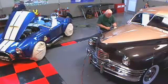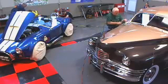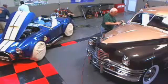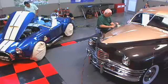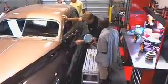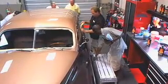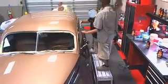One thing I know, and this is a personal thing, is I hate getting splatter on other people's cars. I don't want them to use my name as a cuss word down the road every time they look at it, because those rubbers, with the silicone that comes from these compounds, stain them, and then it's hard to get them off. I found that a little bit of thinner would be good. You run the risk of damaging the paint, though. You dull the paint down. It's always easier to just go ahead and tape it off.